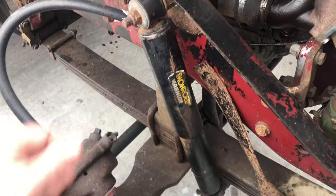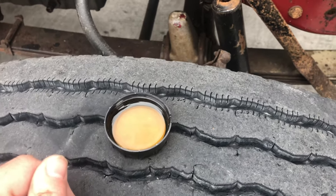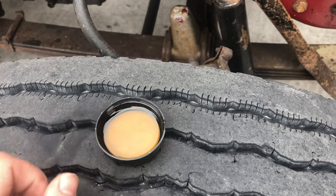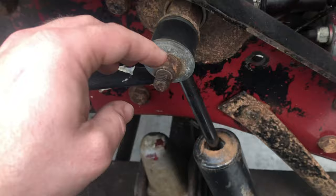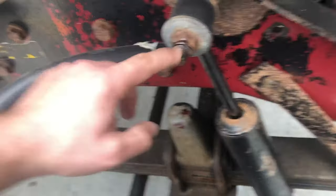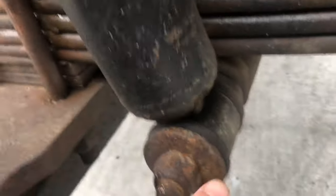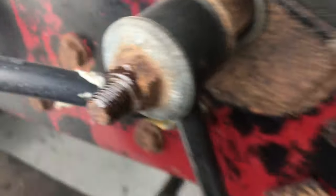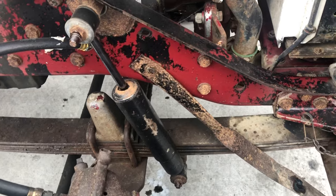It's really not a brain teaser how to change a shock absorber. I don't have any penetrating oil - I looked all over the truck - but I had an empty jug of 15-40 and I turned it over and collected a little oil in the cap. I'm just going to put a few drops on there. Obviously penetrating oil is better, but if you don't have any, regular oil has kind of a leaching property - it won't penetrate as fast but it will seep its way around and let those nuts come off easier.